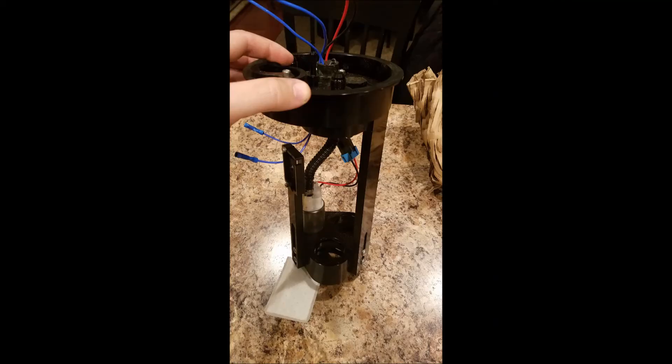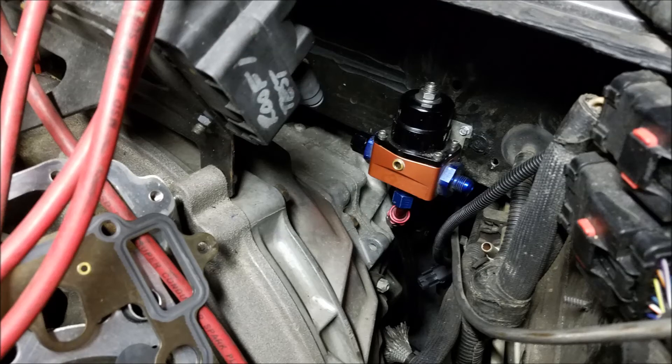Instead I went to RSI — they make drop-in fuel buckets, usually a dual pump setup, but I asked them to just make me a one-pump configuration since I'm not running turbos. These setups can hold up to three pumps and dash 10 or 12 lines, built for guys running twin turbo big horsepower, but I just needed the single pump deal and they were totally fine with it. I also relocated the fuel pressure regulator to an easier spot, away from the exhaust and intake, which also hid things and made it cleaner. It feeds two fuel lines on either side to the back of the intake.